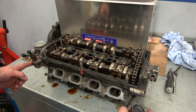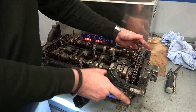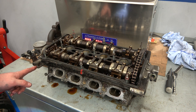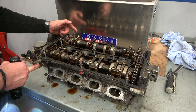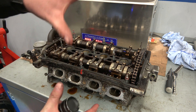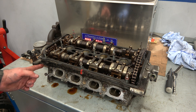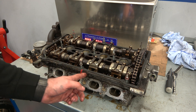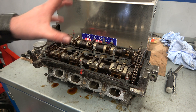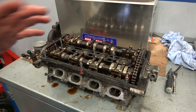When I measured this cylinder head it was just shy of 50 centimeters in length and about 27–28 centimeters in width. I measured it to fit in this ultrasonic cleaner — that's why I bought it. The area where the lift-up eye is and where the timing sprocket goes for the camshaft is too wide, so I'm going to have to put it in lengthways. It will show you how good the cleaner is because it will clean 50% of one side while the other side stays normal.